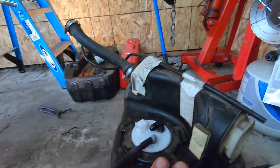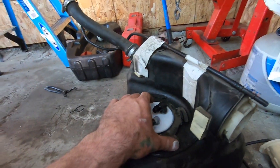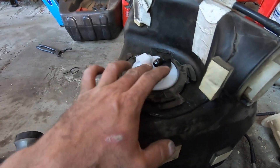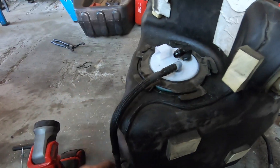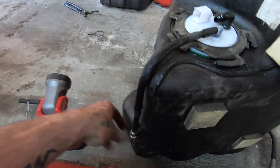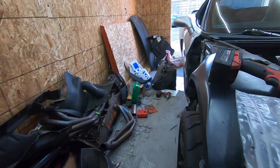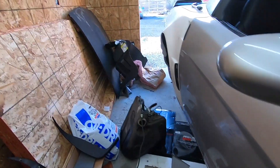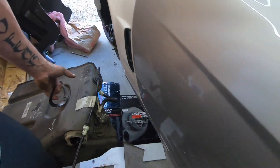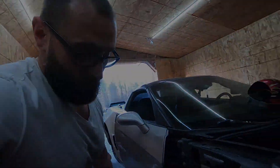Alright guys, we got the pump in — it was 10 times harder than it needed to be. The seal looks like it's in the right spot, lock ring is in. We just have to make up the return line and get that run to where it needs to be — I'm going to follow right along with the stock fuel lines. Next let's get this other side tank over, get the sending unit out, and get that block-off plate installed. I'll speed time-lapse this going on.